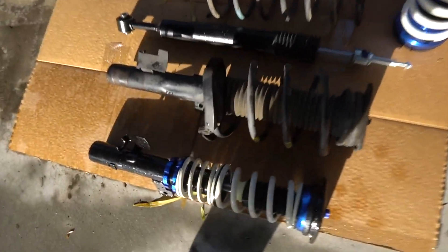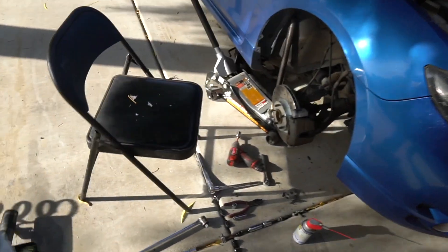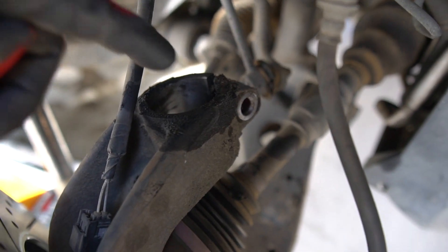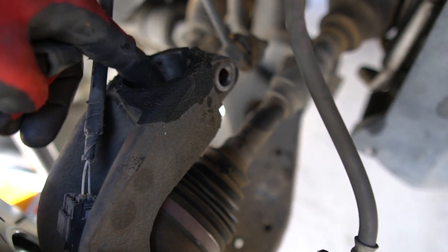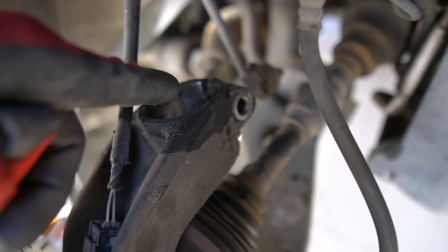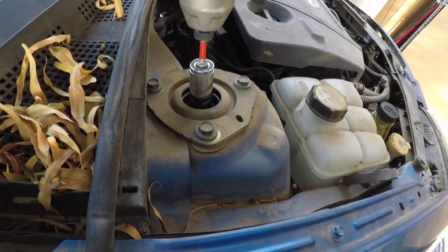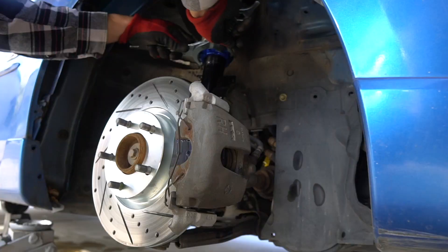This is definitely not the hardest part at all. I did have to drill that out just a little bit so that the brake line fitting could go back in there, but other than that it's pretty simple. It's basically just slap it on in there and bolt it back up. One thing I've heard a lot of complaints about though is that if you don't clean all this stuff up and lube it really well, then that new strut is going to have a hard time slipping into place. So I'm going to get something to clean this up with and we'll drop it in. The other side looks about just like that as far as the threading goes — tighten these guys up.